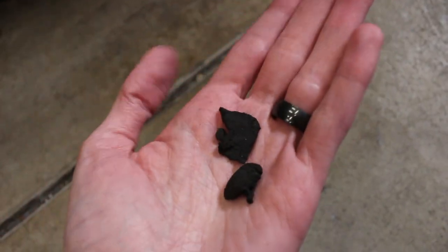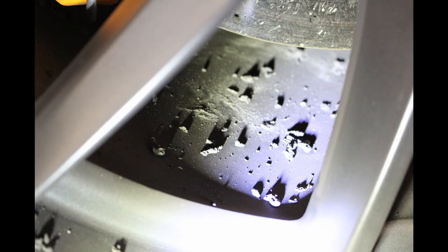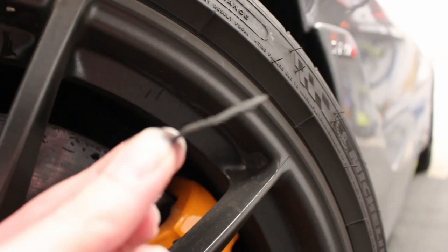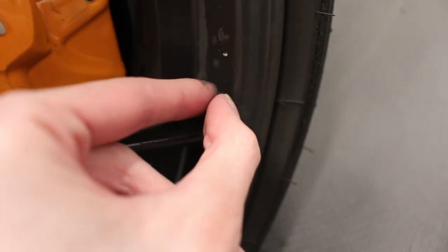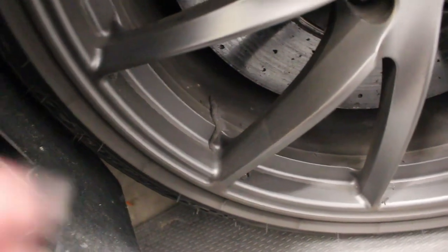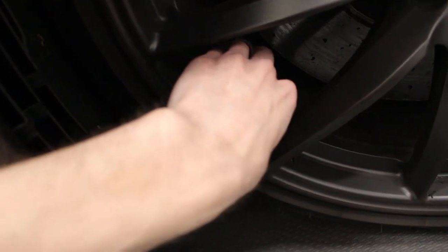That's just rubber from a tire. It comes off and flies onto the car, it gets stuck to the paint, and it gets stuck to the wheels. The rubber that gets stuck to the wheels is full-blown rubber. The rubber that gets stuck to the paint is more like a skid mark almost. It hits the paint, it's really hot, and it rubs off and leaves a big rub mark of rubber on the paint. Whereas when it hits the wheels, it just sticks and leaves these giant Play-Doh type objects stuck to the wheel.